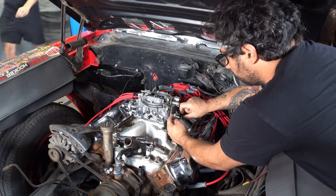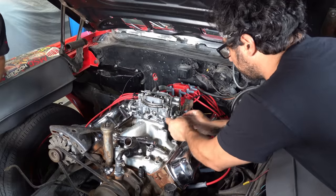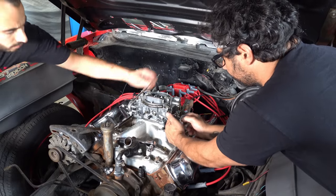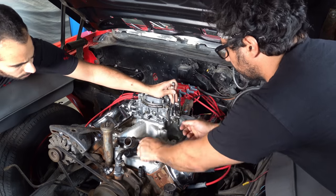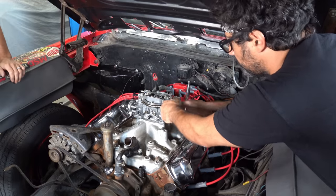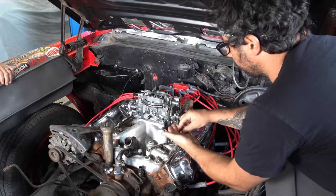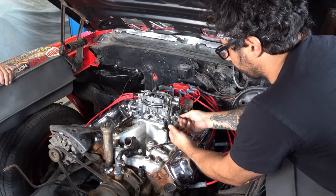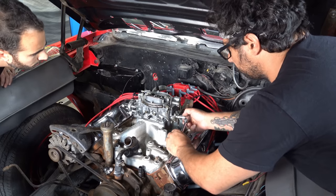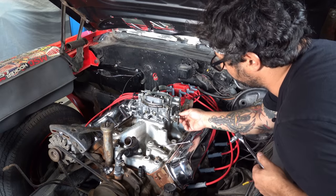So if you need to, you can take a bolt through, toss a nut on the back side. All right, just tighten it all the way up. Make it tight. You on there? You got it? And you come back here and put a nylock on it so that this thing can rotate pretty happily. This will get you down the road. Washer? Now I gotta see how much. You really need a longer bolt, but that'll get us there.